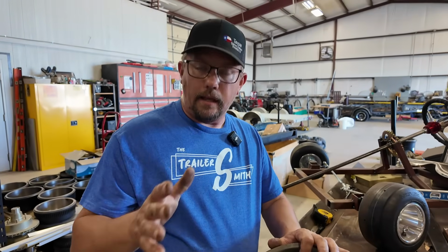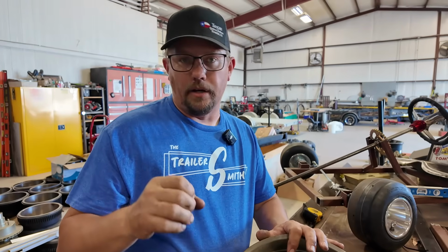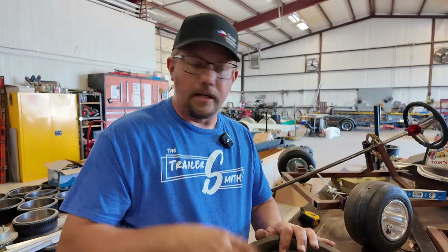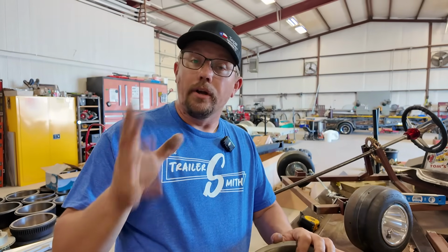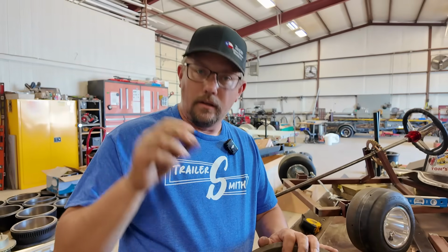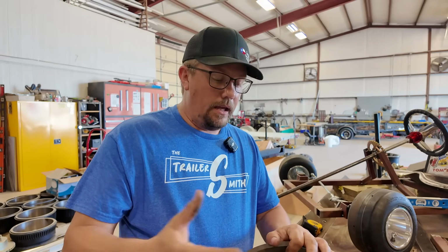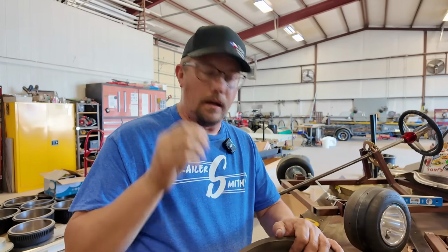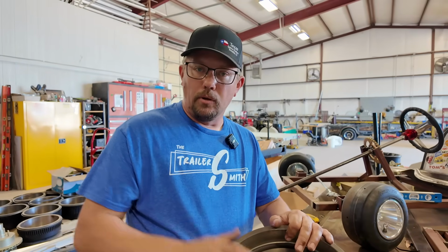If you go today and buy a brand new travel trailer on the yard that has 0 miles on it, it was hauled in on a trailer from the factory, it's never been on the road, you hook it onto your tow vehicle, it's going to have little to no brakes on it right at the beginning. And that may surprise you, but if I were to work on it and put a brand new brake system on, replace all the components and do everything to the book and beyond, it's going to have little to no brakes on it when you pull off.